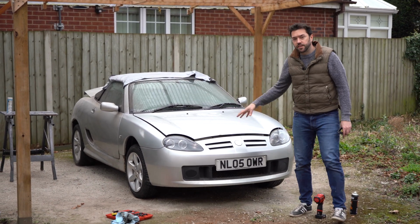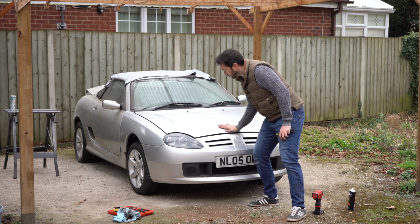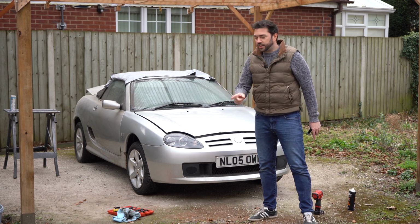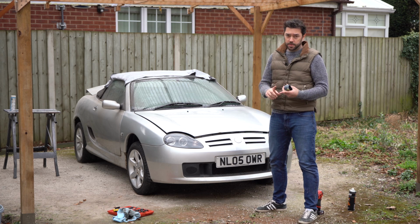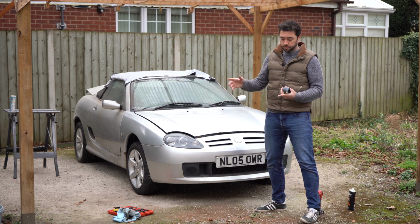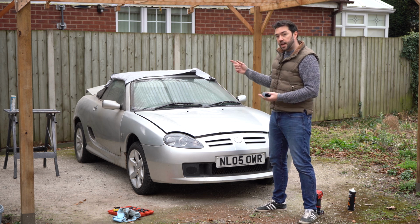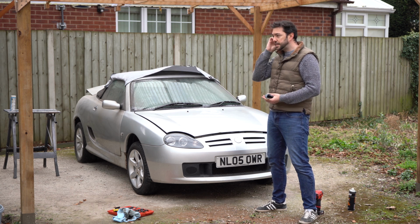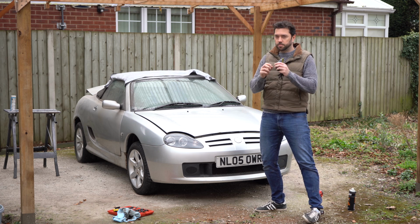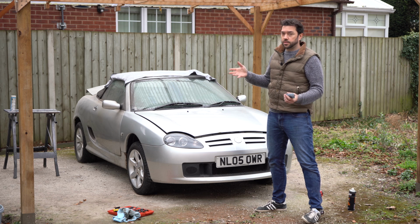Right, well, that's my least favourite job ever, and this car just seems to be one of those that when you solve a problem it gives you another one for free. But in the next video it's all about starting the thing, finally. Now there are some bits and bobs to do in the next video before I do that, like put the battery in, put oil in it, change the oil filter, or the other way around, air filter, some water in it, not coolant, just in case there's any leaks. The ignition coil bits, some pipe work on the coolant. I need to drain the fuel out, put some new fuel in. So there's a few bits.